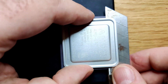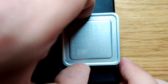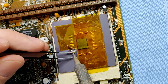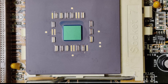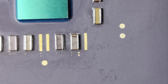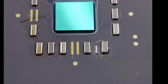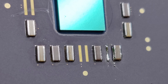If you watched some of my previous videos, you may have come across one where I removed the aluminum heat spreader of an AMD K6 II Plus. By moving a surface mounted resistor, you can double the level 2 cache of the CPU. There is a chance, however, that this may not work — the disabled cache may be defective and was therefore disabled by AMD. The CPU essentially becomes the K6 III Plus with 256 KB of level 2 cache. In this video, I want to test if the unlocked cache works without issues.